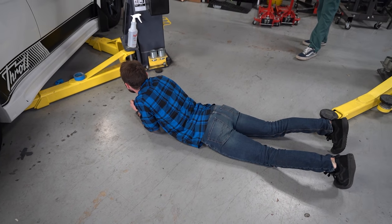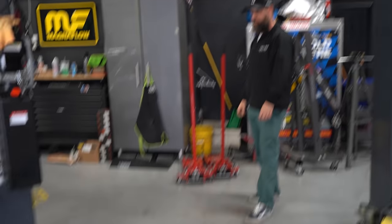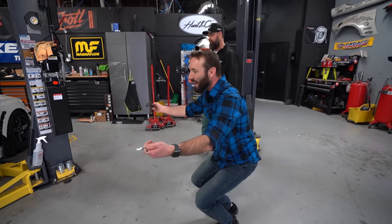You don't want it straight based on body lines, because cars are round and do weird things. If you base your graphics off body lines, it's almost always not going to be straight. You have to go off what makes sense to your eyeball — stand back and look at it. If it looks straight to your eye, it's probably really close to straight.